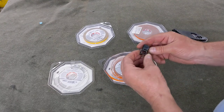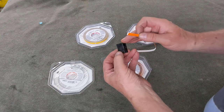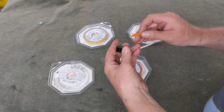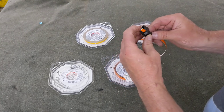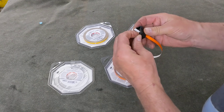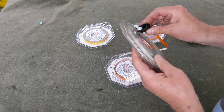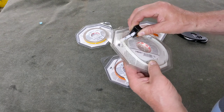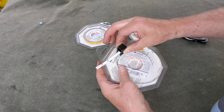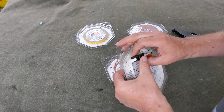Actually, I found this little one here to be the most universal. You feed the tape in through here, and you separate it — that goes down and attaches to the rim that you're trying to stripe. As you roll along the rim, you can see it feeding and separating the backing from the actual tape, forcing it down.